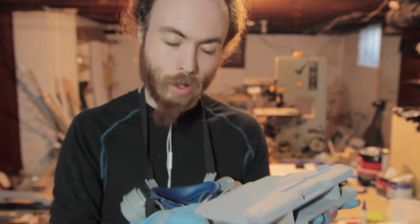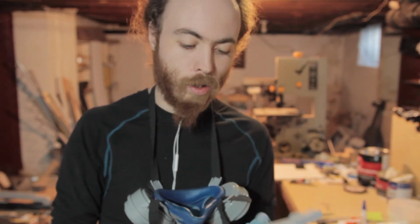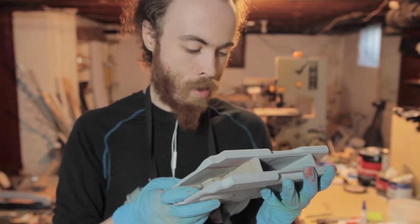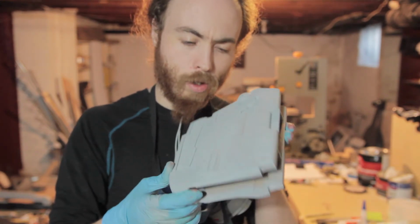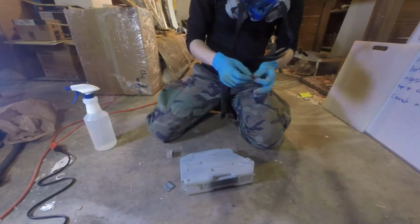So making good progress. And yeah, first I'm going to wet sand it to 320 grit in order to knock back some of this overfilling. Slight bit right there. And taking that over the whole surface will make it nice and glossy, which means that there's nowhere for those little nooks and crannies to hide. So we'll know exactly what we're looking at filling wise.